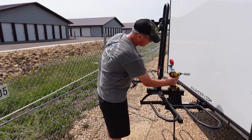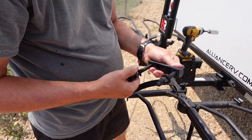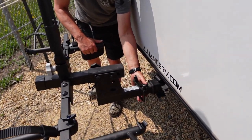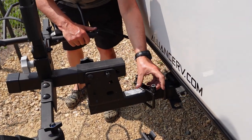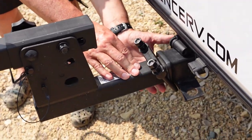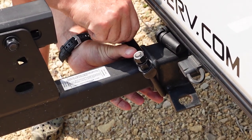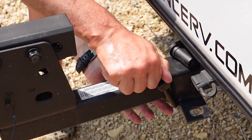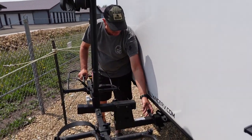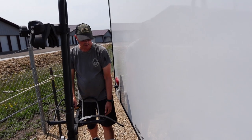The other really important piece is this stabilizer U-bolt. The easiest way to put this on is to have it on the receiver before you slide it in. It's just a washer on the bottom, a nut, a lock washer, and a nut. You put it underneath the receiver, mount it down, and tighten these up. Once you do that, this rack becomes rock solid and doesn't move around at all. That's a really nice feature — having everything locked down tight so nothing's flopping around.